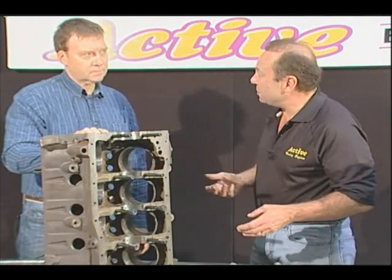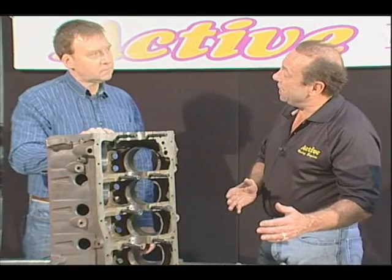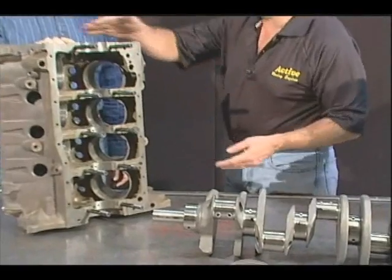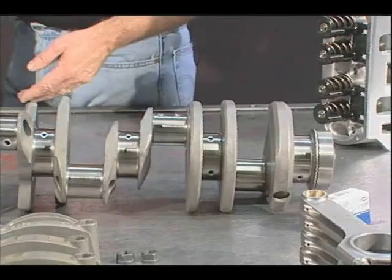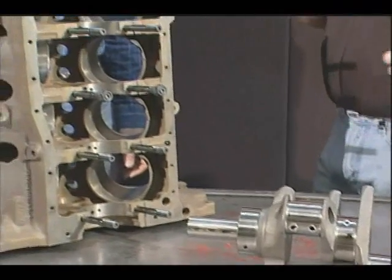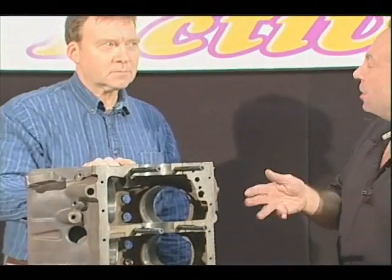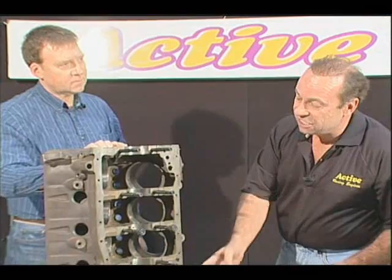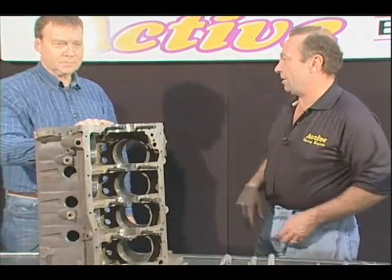What the align honing does is it makes the housing bore exactly round. Because I control the housing bore, I also control your bearing clearance. So what we do is we have your finished crank and your finished main bearings — we actually take it out. There's a tolerance when you open the book and check the spec. We'll take the housing bore out to the low tolerance, snap a bearing in, check the clearance right then and there, and nail your bearing clearance — perfect main bearing clearance. It also lines up all the main saddles so that your crank just turns like glass. And that's a blueprinting operation.